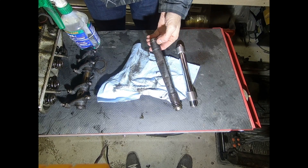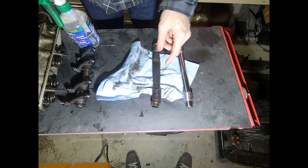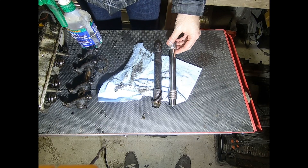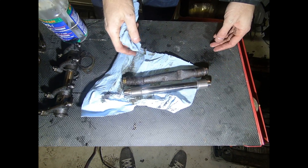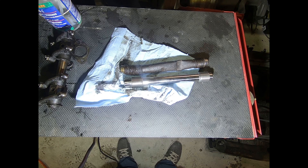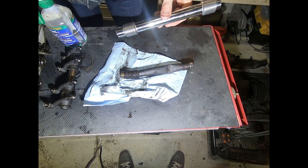With the engine pulled apart, here's a shot of the old pushrod tubes — obviously they weren't damaged this bad before I pulled them out — and here's a new stainless steel one beside it. Stainless is stronger and won't rust, which is a known weak point on old Volkswagens. One thing you notice putting them side by side is that one end is quite a bit longer than the other — about twice the length — which I hadn't seen before.